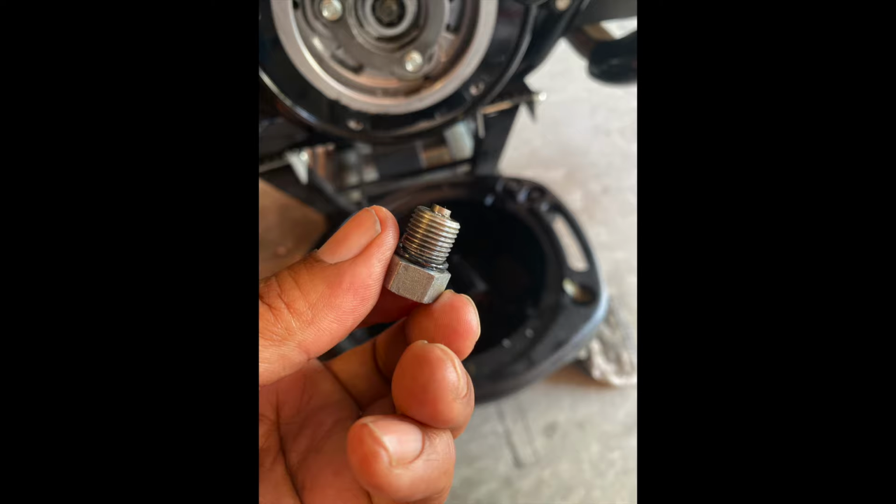So I took the plug out to drain the primary, and that went well. And I put the plug back in there, and I hit a little hard spot. The screw was straight. It was going in straight. It went in straight, all of that. But I hit a little hard spot, and then it went on up in there. But when I backed it back out, it came out with the threads on it from the case.